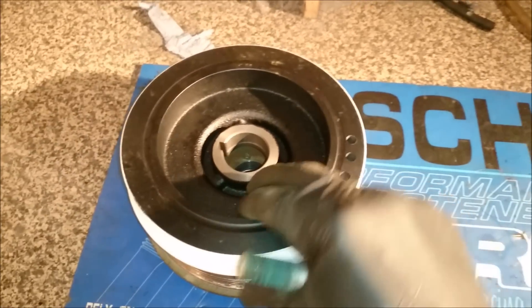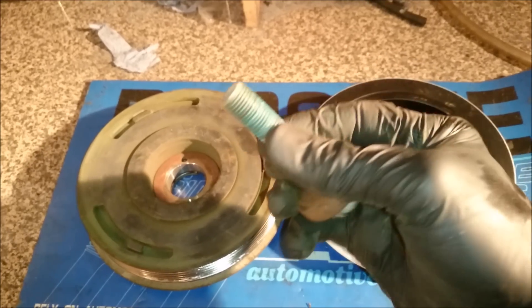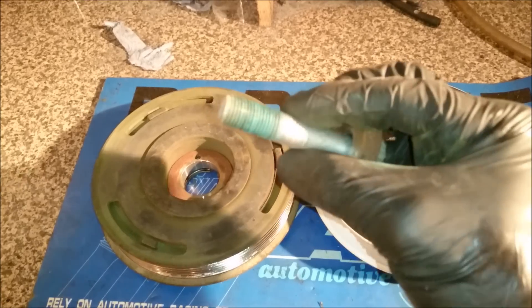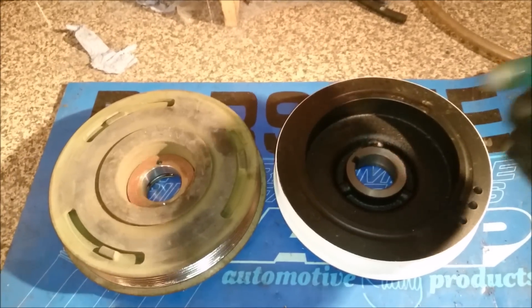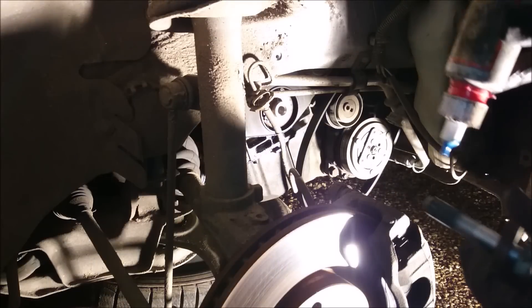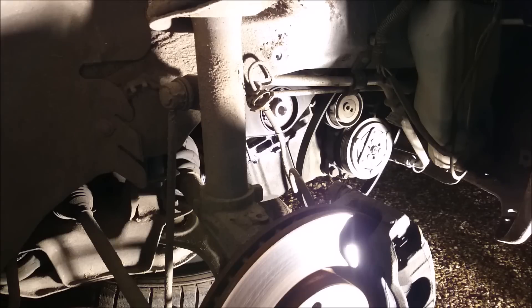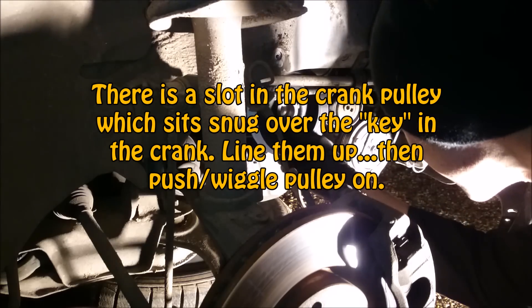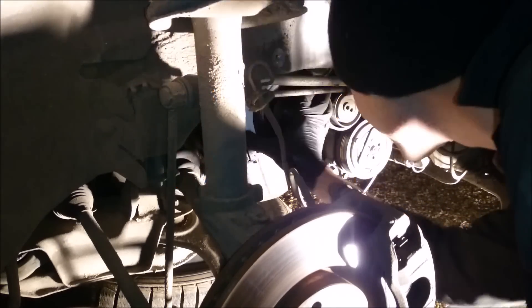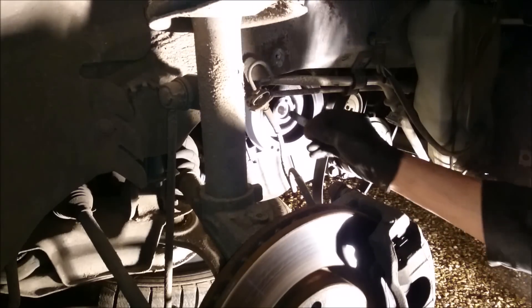It's always worth checking — just overlaying and making sure they're the right size. Sometimes they'll come with a new bolt; it's not a bad idea. If they don't, don't panic — just clean off all that thread lock that's already on there, make sure there's no problems with the thread, and then fit it. If you're worried about this, do buy a new one. So we're going to clean that off now, get that ready, then apply thread lock to the crank bolt. We're going to line our pulley up with the key in there — it should just wiggle on nicely — and then the new bolt goes on.